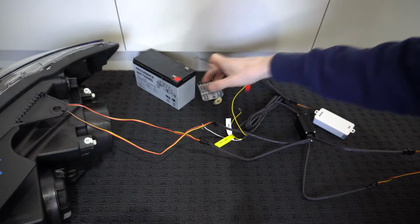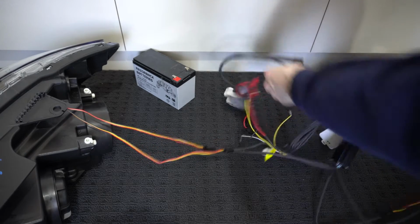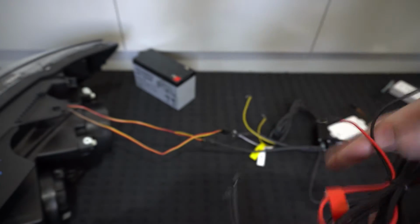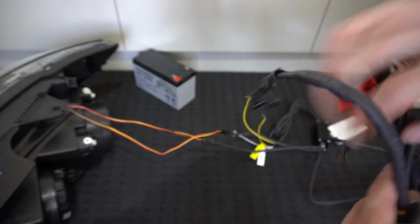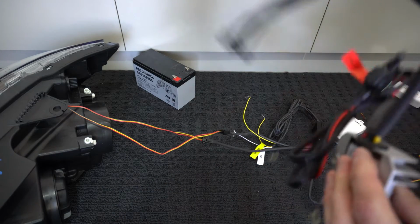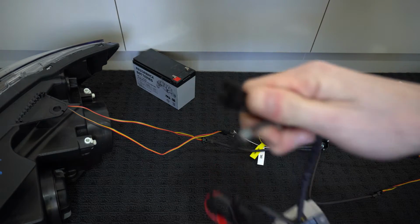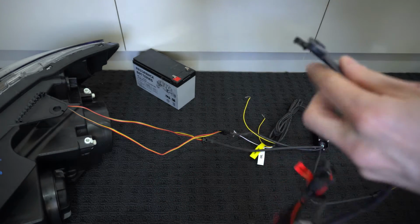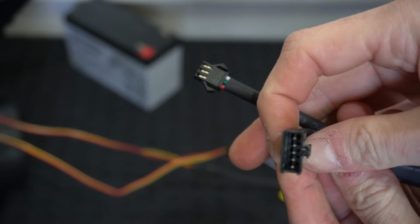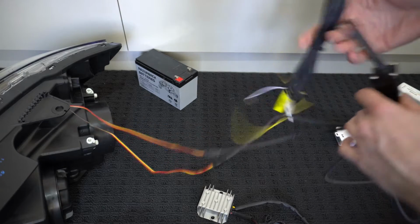Alright, so there's a bit going on here. I'll disconnect them for now, and disconnect our modules. So our first module is our power supply. Red and black wire, obviously positive 12 volt, negative. We've got a fuse built in, that's a 10 amp fuse for our power supply, and then we've got our output. So our first plug, the bigger plug, if it's going to focus, probably not. We've got two plugs. We've got the smaller one for our Bluetooth module, bigger one is for our driver. So that's our power supply. Next is our driver.